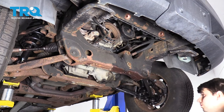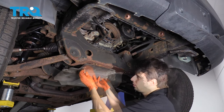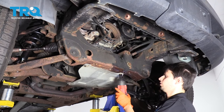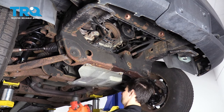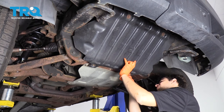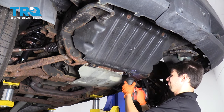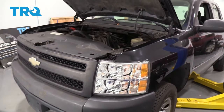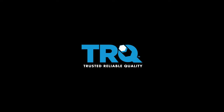The next and last step is to put the shields back on. Start with the rearward shield — start one bolt in so you can let go, then start the other three. Tighten up with a 15 millimeter socket. Then the last thing is to go get yourself a four-wheel alignment.